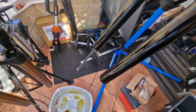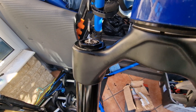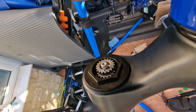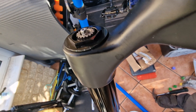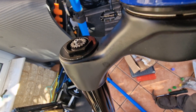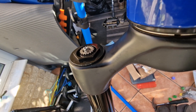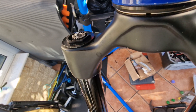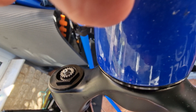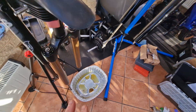The lowers are off this fork now. The top bolt is different — according to my adjustable wrench it's between 25 and 26mm — so again I'm going to try and remove it as gently as I can because the aluminium is quite soft. I did put the grip control right to off, so I know where it needs to sit when I reattach it.